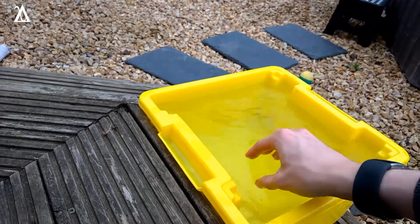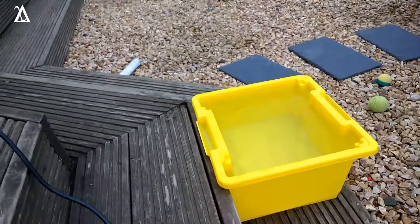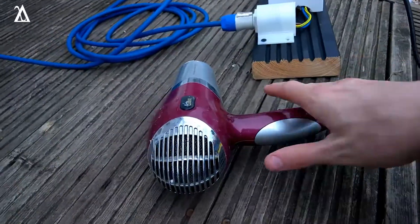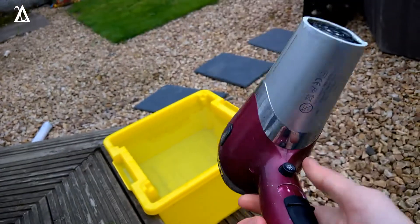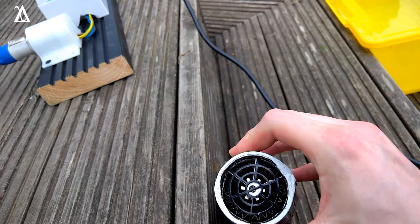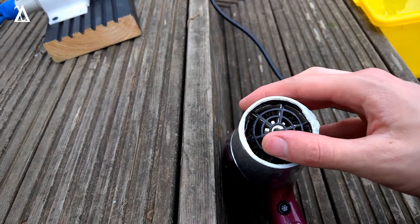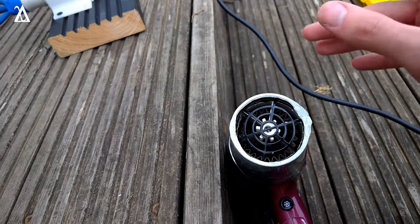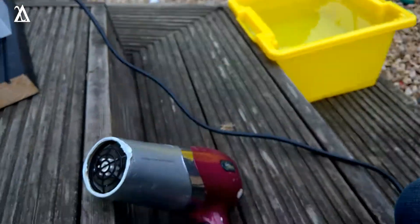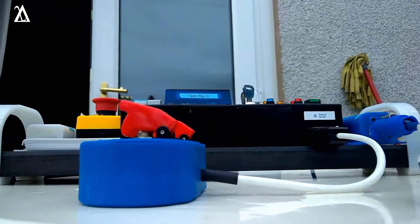The water where I live is quite pure and relatively salt-free, so the conductivity of it is quite low. That should mean that putting things like this into it will not affect the current level much. But since the element has a positive temperature coefficient — the resistance increases when the temperature of the element increases — the cooling effect of putting this in the water will cause the element to draw more current, because the resistance has dropped. And we should see that on the ammeter up there.